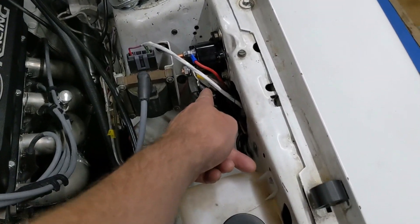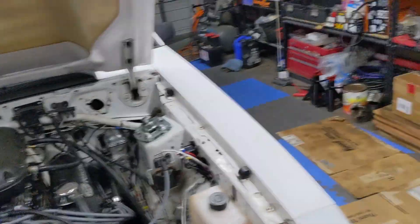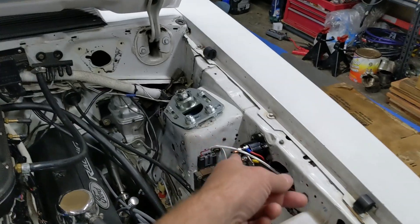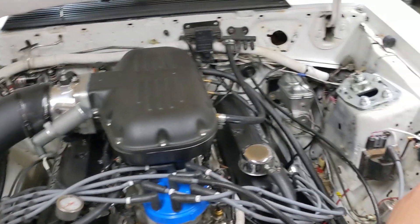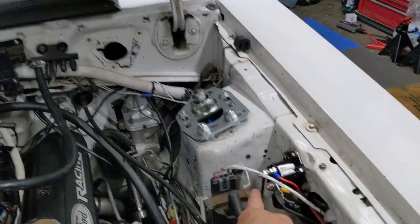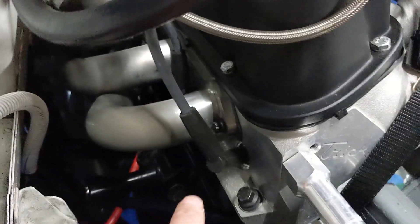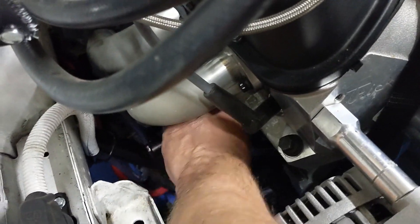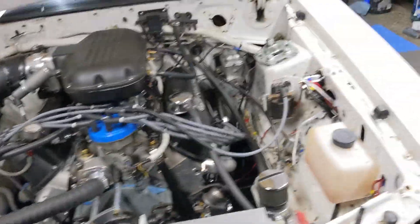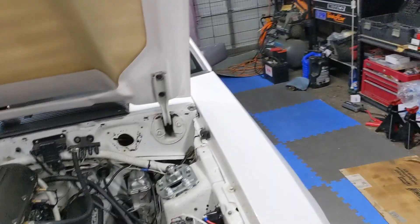I've never replaced those since I've had this car, so I went ahead and got a new solenoid, a new starter, and made a new cable to replace the burned one. I had extra cable from the battery relocation, so I cut and soldered on new lugs — made my own custom cable. It's actually a thicker gauge, a 1-gauge, versus the standard 4-gauge that was there before. I routed it wire-tuck style, all wrapped up with a sheath, running down underneath the oil pan and tucked up inside the engine mount back to the starter, so there's nothing to go against the headers anymore.